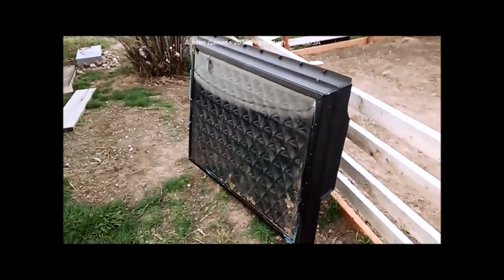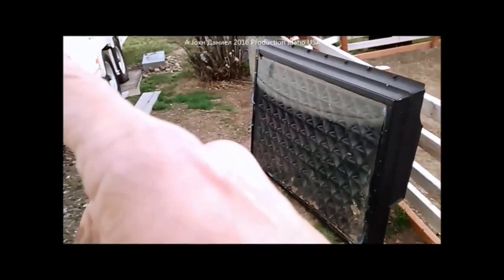All right, take a good look at that baby. It's pretty good size. I've got enough room for 12 panels up there and 5 feet of open space in the dead center. Since there's no AC unit, this trailer has a spare tire hole underneath. What I'm doing is taking an 8500 BTU air conditioner, cutting it in half basically, putting the condenser unit down underneath with a blower on it, and up inside the trailer where the heating unit used to be, where all the duct work is, including two that come up high, is going to be the rest of it, and it'll blow into the duct work of this trailer.